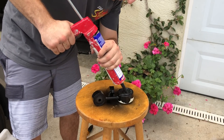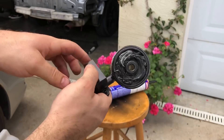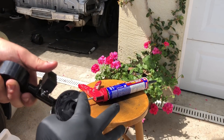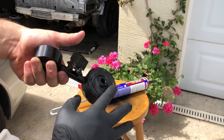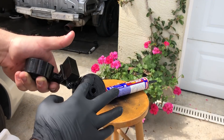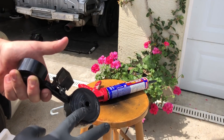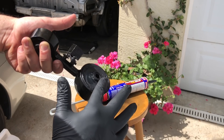The next part is going to be a lot easier if you have some gloves so you don't get messy. You can see the backside is ballooned because it's nice and filled. For the front it all looks like cake frosting consistency — I'm going to get a glove on and smooth it out. You don't want to get this stuff on your finger because it's a pain to take off. The dry time really depends on how much you use and how thick it goes in, but it's normally about a day or two — I like to keep it about two days with heat from the sun before putting it back in the car. There are different types — this isn't the strongest one, but since this is just a daily driver that's fine.